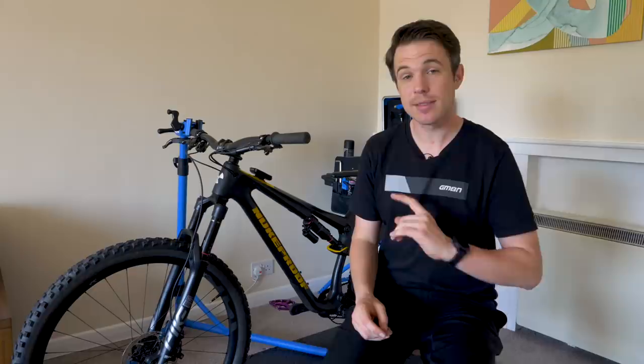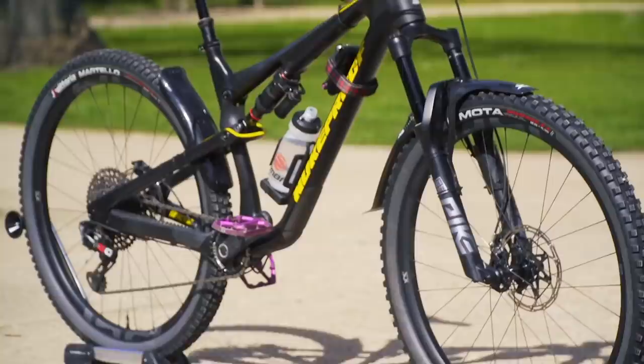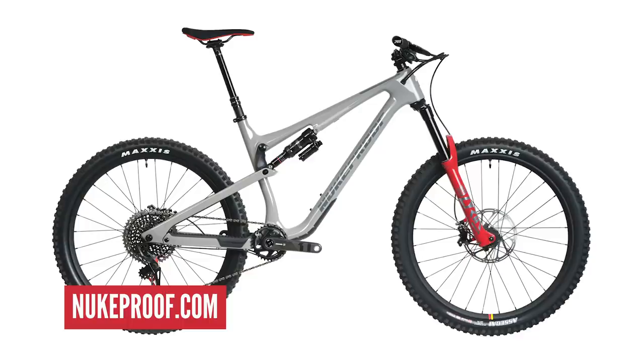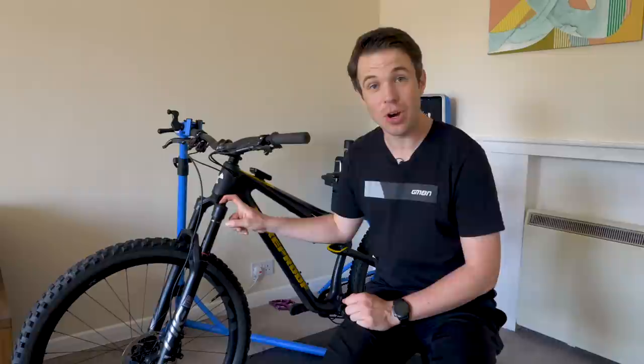My goal is to take this bike into three very different setups. The first is an XC inspired bike, not totally dissimilar from the Reactor ST. The second is the bike as you see it before you — my middle ground, which is my go-to normal riding setup. The third is a setup where I'm going to try and increase the rear travel, but also give it the same head angle as the Reactor RS. The RS is the most aggressive bike in the Reactor lineup and comes with a 10mm longer fork as stock.